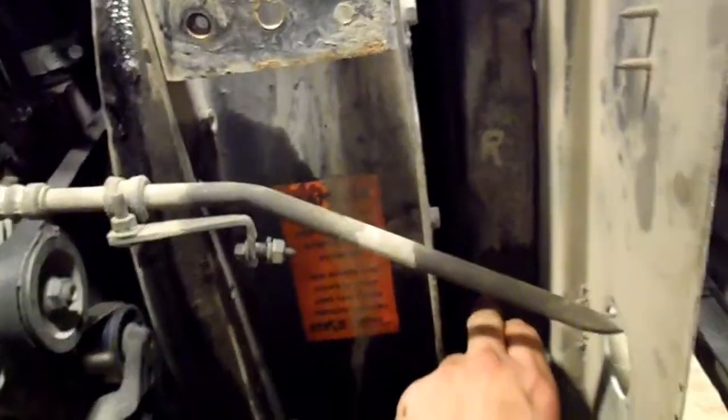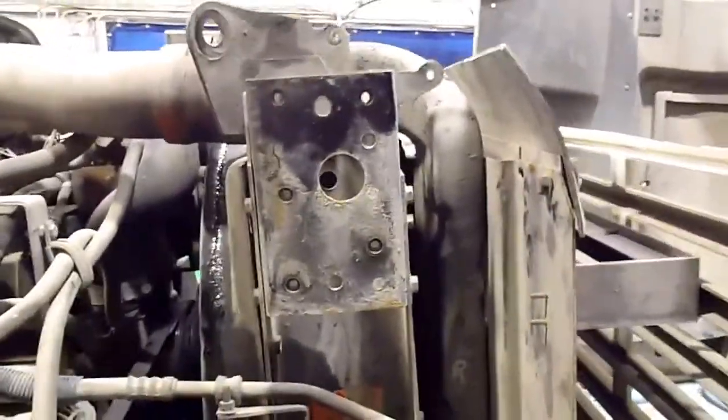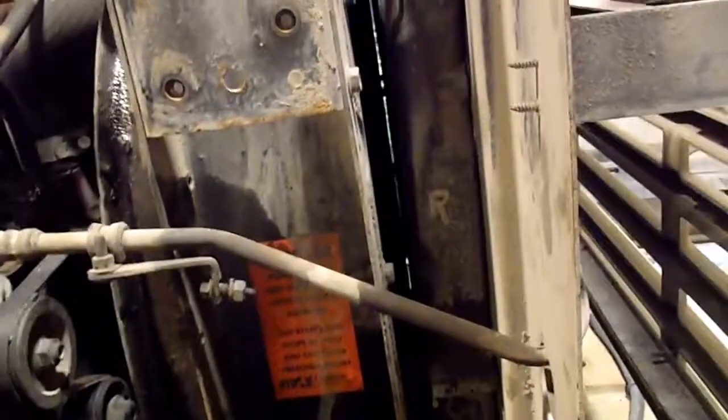It's not that much worse. Everything, I'm going to pull that all out as one piece, I believe. Basically, I have to pull the air-to-air out, so you have to make sure it's unbolted from this frame that holds your condenser core on, and then it should be free and you can pull it all out. The other truck was easier to change the radiator on. It's a quicker job because I could leave the air-to-air in it. I believe it's been a long time since I did that.